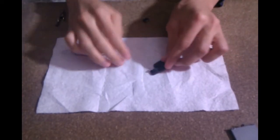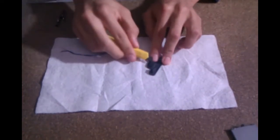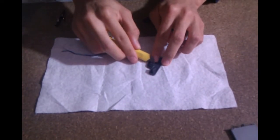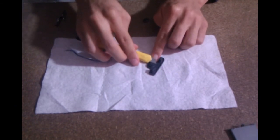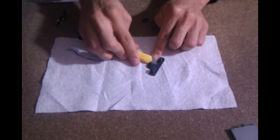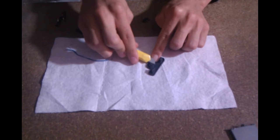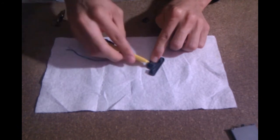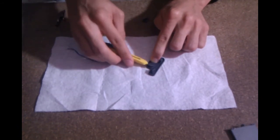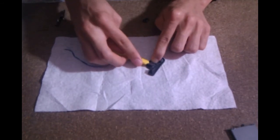This is the start, select, and PS silicone insert of my controller, and what I'm going to be doing is using an X-Acto knife to remove a small layer of the silicone material and use that as a recess area for my surface mount LED and wire to sit in. Just be very careful, remove a nice thin layer, don't go through, because there is a conductive pad directly underneath the center of the PS button. As you can see, I'm just going down a little ways and sliding the knife under.